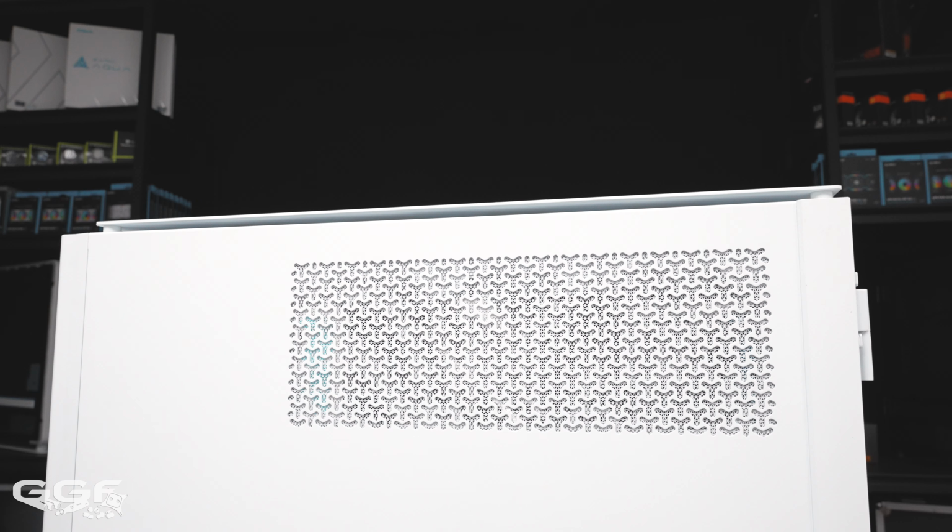The final location is at the rear, and this spot holds up to a 240mm radiator, providing fans go first, or a single 140mm fan if going with 360s at the top and push to the front. If you have 480s along the top, there was no chance a 240 radiator was going to fit here at the same time. Only fans will fit in this area.